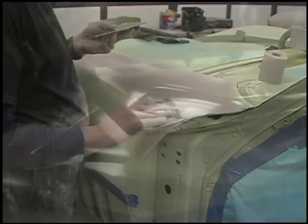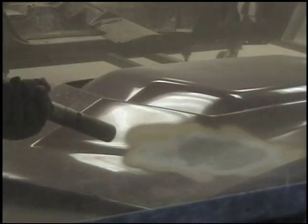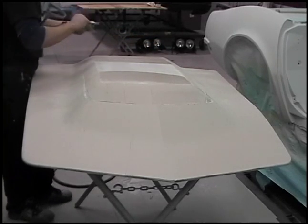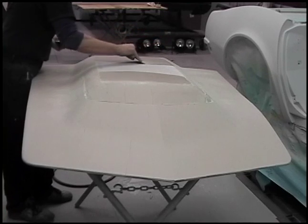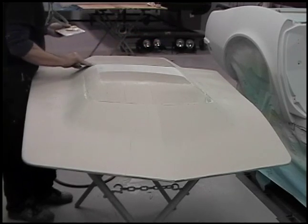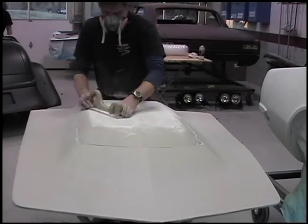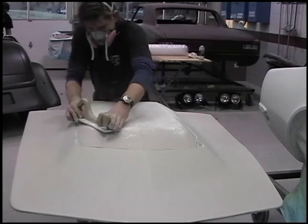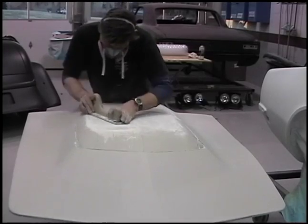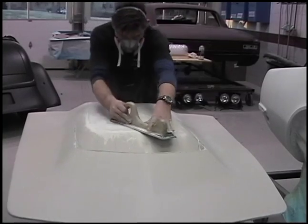Because this car looked like somebody had actually sandblasted the hood prior to us stripping it, all those resins had been blown away. If you remember, the hood was really starting to crack all over the place when we took this car apart. So we have to deal with that. What we did is use a polyester-based filler, which is a very high temperature filler — good to over 400 degrees Fahrenheit. That will hold down all those fiberglass strands so you won't see them popping or crazing later, especially important on areas that take a lot of heat, with this L88 motor making huge horsepower and heat underneath the hood.